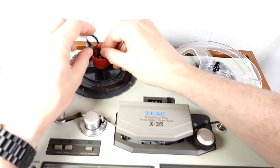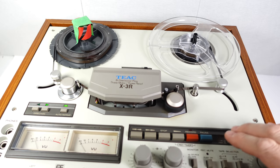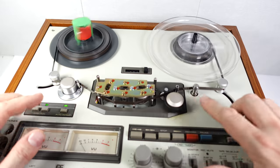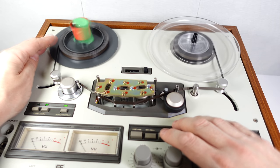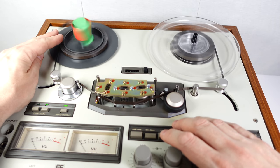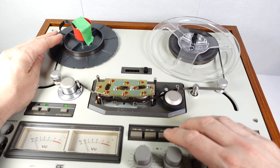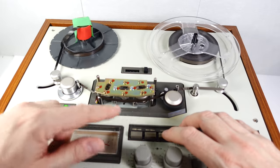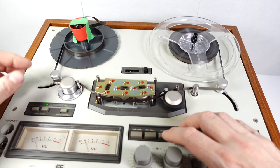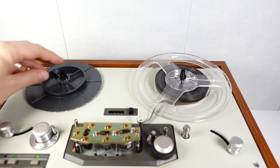I haven't put the twist in the tape yet — I want to get it onto this reel first. Initially playing it caused a slight jam, maybe due to the different reel heights, but fast-forwarding worked. I'm keeping my finger above it ready to stop if anything goes wrong. The VU meters are moving because audio bleeds through from the other side, but I'll need to spin it over before copying it properly. The tape is now on a proper spool and will be much easier to handle.